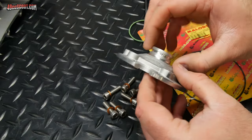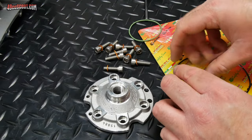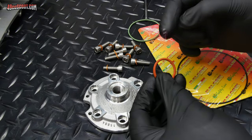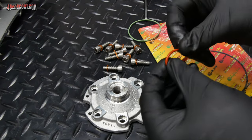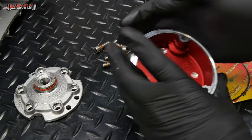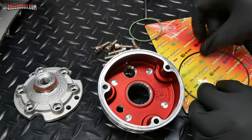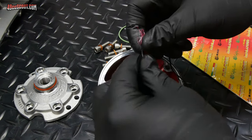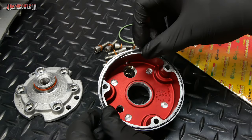Now on the other side of this, there's a groove here for an O-ring, and you'll find an O-ring that should fit it here in the kit. So I'll take a very small amount of grease and lightly coat that. Then you can just kind of work that down there and into the groove. Finally, the cylinder head cover has an O-ring groove that I'm gonna hope matches up to this O-ring here, the last thing in the kit that's left over. Very, very small amount of grease. Just kind of rub that all the way around there and into it,